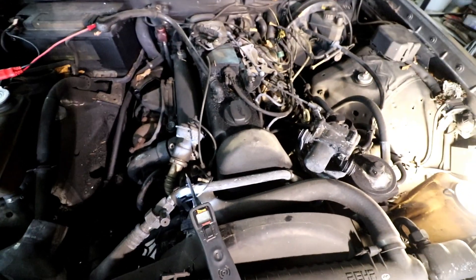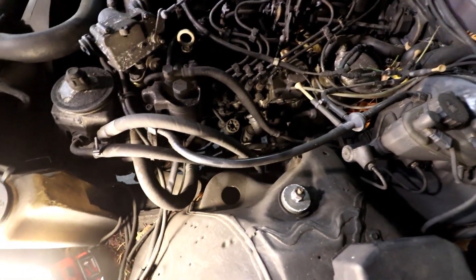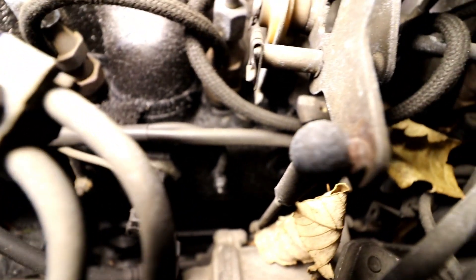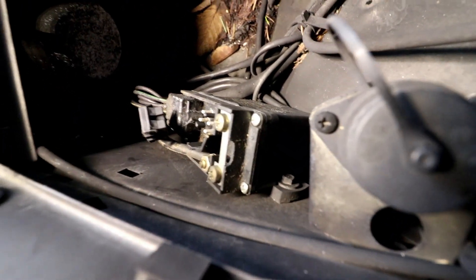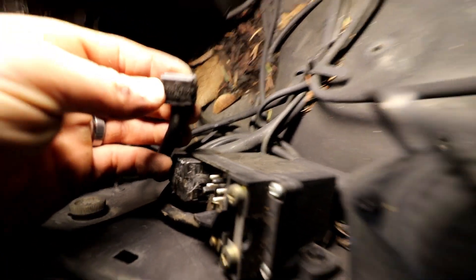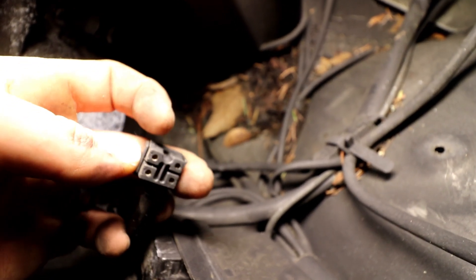Today we're going to use this on a diesel Mercedes. Before I pull this engine, I want to confirm which one of these bizarre 80s-style electrical connectors is our glow plug relay. I feel like I know where it is. You can see where the glow plugs are, where that little nut is, and there's a wire coming from it — there's five of those. You follow those all the way back and it goes to this box right here. Now this box has some mystery wires coming out of it. I think this goes all the way back and disappears in there, so I'd be willing to bet this is where our ignition source is coming from. I don't know why there's four connections to turn a relay on and off — there must be two that go to the light in the cab, and then maybe one ground and one positive that actuates this thing.